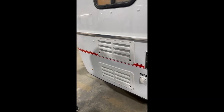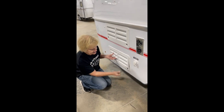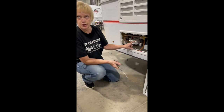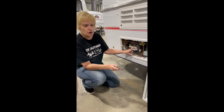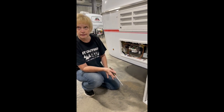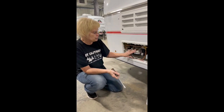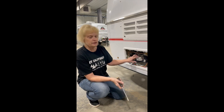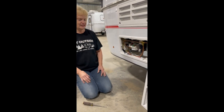This here is how you're going to start your refrigerator. It takes this refrigerator four to five hours to get cold. You cannot do that on your battery option — the 12 volt, which is the red button. Your 12 volt is only a maintainer. So say you're going to be at home getting ready to go camping — plug in and get your refrigerator cold on the green button, which is your 120 volt. Now your refrigerator is cold, you're hooked up to your vehicle, you're ready to go. You can switch off the 120 and switch on your 12 volt and it will maintain the coolness of your refrigerator. Keep in mind you cannot run two of these services at a time — it will wreck your refrigerator.